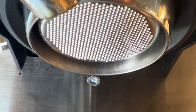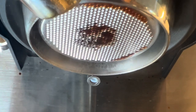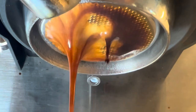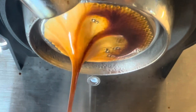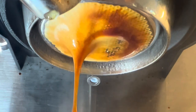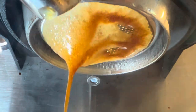Then I pulled a regular shot using the right grind setting. Now it came out a little more centered, and the screw is loosened a little bit. But as the shot progressed, it tended to the left, and it's hard in this current profile to bring the flow down to very low. Otherwise, it seems to make this problem worse. So the shower screen or the dispersion screen doesn't seem to be working well at low flow rates.